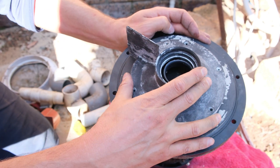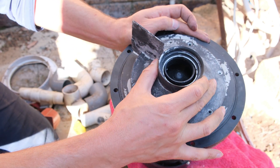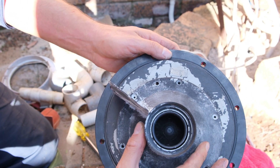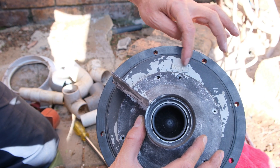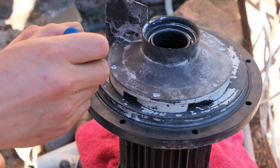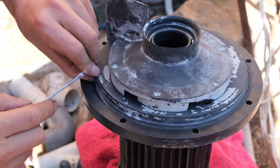Now it's time to put the diffuser on — it can only go in one place. Notice that it seats like this and all three screw holes align. Looking at it like a clock face, with the brand label visible, it's aligning to about 10 o'clock. I screw in the three screws. There's a seal going around here, so I'm removing the old seal and replacing it with a new one.